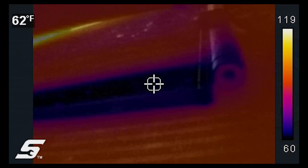I just took a couple of snapshots with the thermal imager. Here we can see the lower portion of the AC condenser. The hottest part of the screen was 119 degrees and the coldest spot was 60 degrees. This condenser should never be 60 degrees while the air conditioning is running. Just to the right of my crosshair is where the bottom of the filter dryer is — that's where our largest temperature change takes place. The hotspot in the top left could be the transmission cooler, but it's kind of hard to tell in this picture.